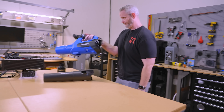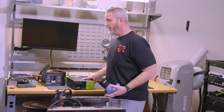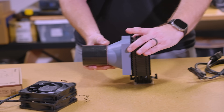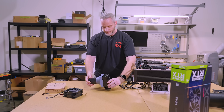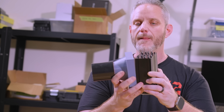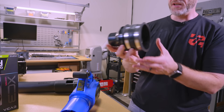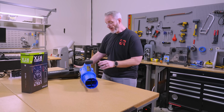So now we're just going to go direct. I have to be careful because the amount of power this thing has is no joke — you guys saw that clip in the beginning, stuff was legitimately blown off the table. Initially I was going to gaff-tape it to the intercooler piping. Look how perfect that fit is right there. But what I found is when I put this coupler on — a pretty aggressive step-down from four-inch down to two-and-a-half — we actually have a lot of back pressure and a significant loss in thrust.